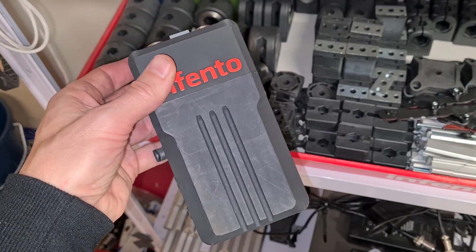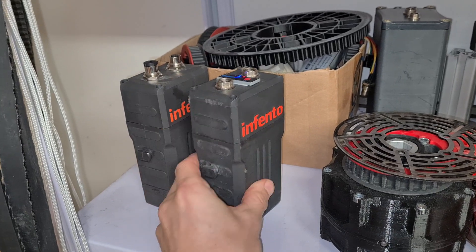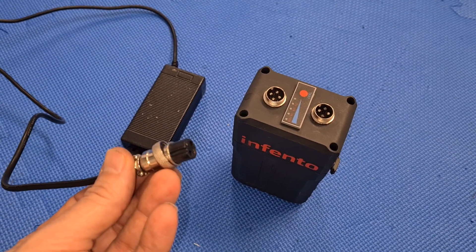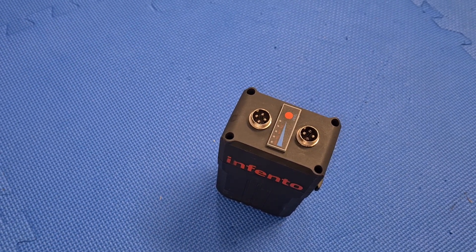Speaking of battery storage — the lithium battery of our ePulse kit prefers to be stored for longer periods in a partially discharged state, ideally around 50%. So don't charge it after each use, even if this corresponds to your sense of order. The battery will lose its capacity more quickly that way.